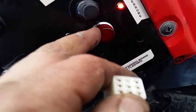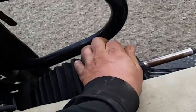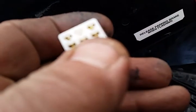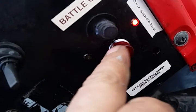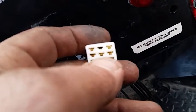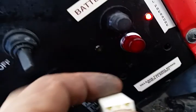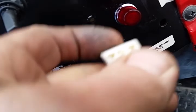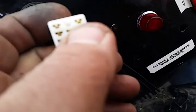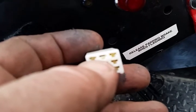On the center pin, for the parking brake light, that pin is grounded when you pull the yoke up. When you take this yoke apart and take the boot off, that switch may be all gummed up and full of crud - you'll have to put a dam underneath it to stop crud from getting in. On the mating end of this connector, you run that to your ground on your light. This is a bi-directional LED so you can run it with either polarity, just like a regular lamp - keep that in mind when designing your circuit. The other side is plus 12 volts when it's on. The top right pin is plus 12 volts when the lights are on and only when the switch is in the on position.